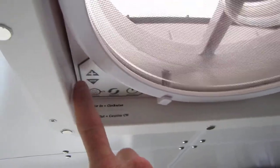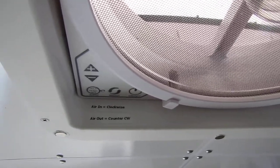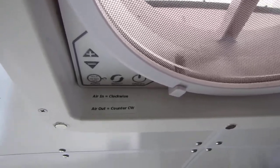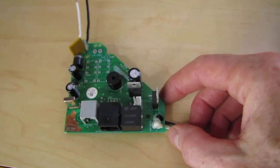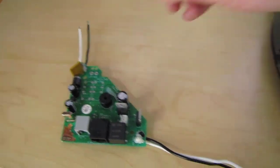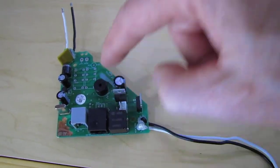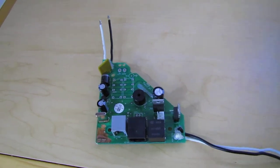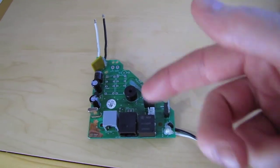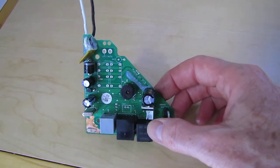I went looking for a replacement board — it's only a year and a half old, it should really be under warranty. I called MaxAir, they're super nice, and one of the techs told me about the circuit board inside here. I'll show you in a minute — there's the power coming in, a connector going to the fan motor, and a plug-in sensor for the thermistor that senses temperature. He told me they've redesigned this board several times for higher and higher voltages, and these boards don't like to see more than about 13.9 volts DC.